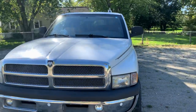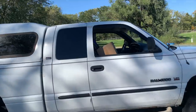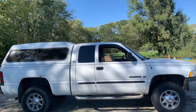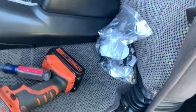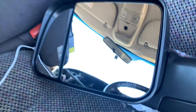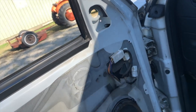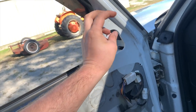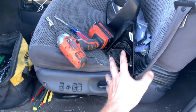Since we can't mess with the Allis Chalmers right now, let's work on grandpa's truck. Got the baby monitor up while the wife grabs lunch. Check out these sport mirrors on this thing — they're heated and power, they function — but I wouldn't mind putting a nice heavy-duty set of towing mirrors on for better visibility and a more aggressive look. We went with some 4th gen towing mirrors, also heated and power. Getting the old one popped out was super simple — just three 10mm nuts, unplug the power control and mirror, and it pops right out.